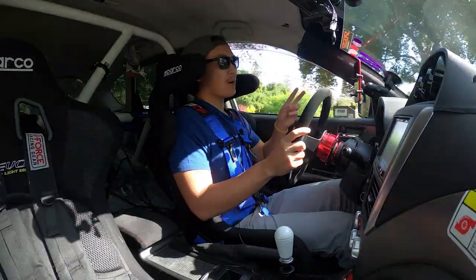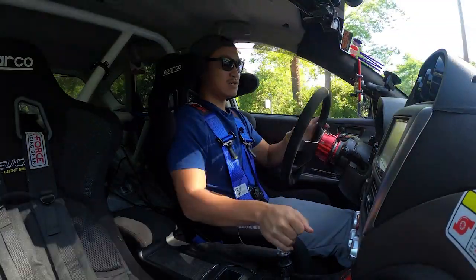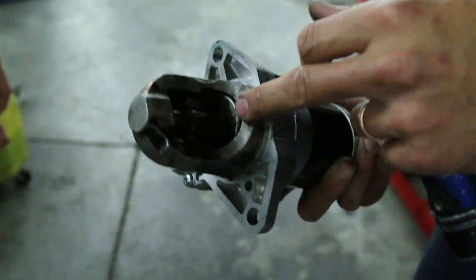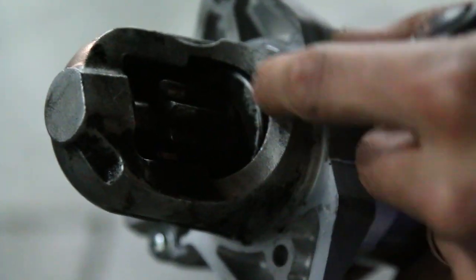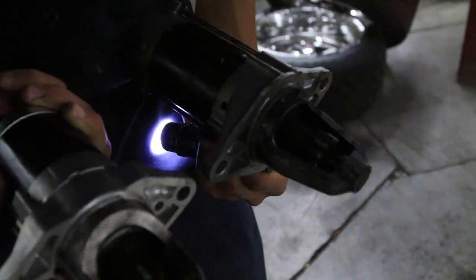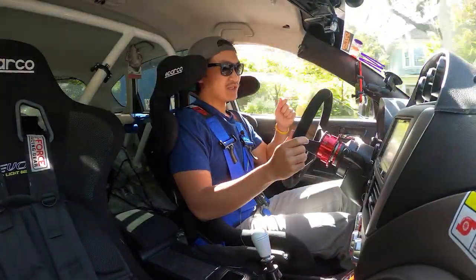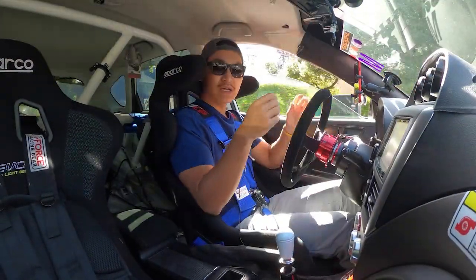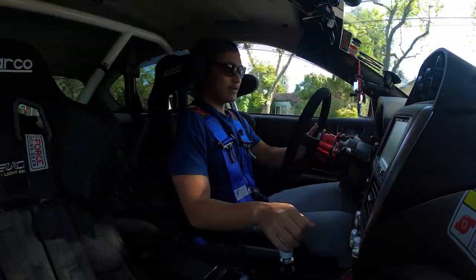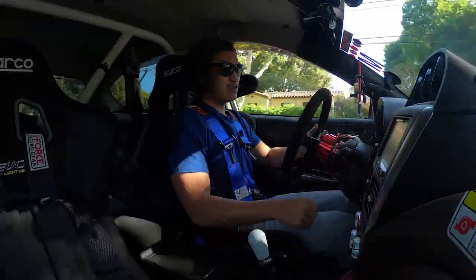The two parts I really didn't think about before getting were the rear diff and the STI starter. I thought the WRX starter would be perfectly fine, but I have a clip I'll throw on screen — you'll see the teeth and the opening of the WRX and the STI are much different. The STI clutch is a lot bigger. I forget exactly which it is, but either the WRX is a push-style plate and the STI is a pull, or vice versa. You're gonna need the STI starter because if you don't, you'll just get click-click-click — the teeth won't be able to grab. STI trans swap is not very difficult to do; just make sure you're looking around, figuring out the best deal for you, and going from there. That's what's needed to do an STI transmission swap on a WRX.